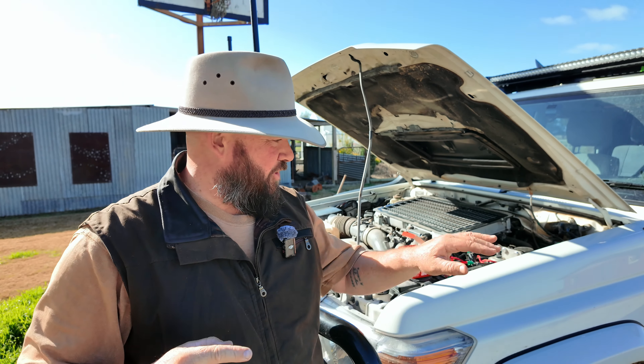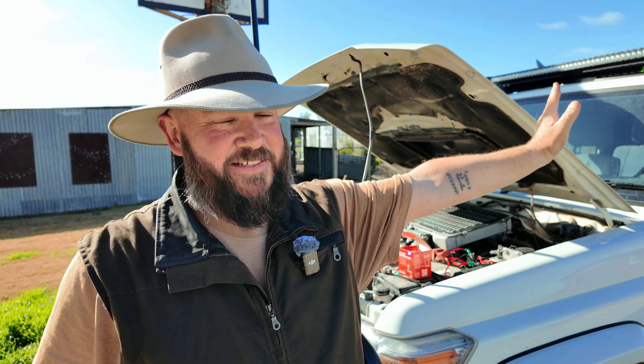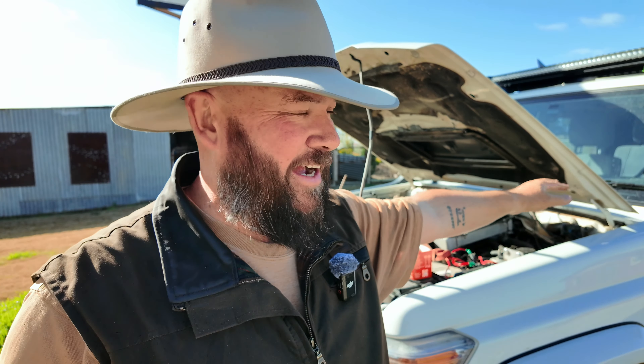My camper trailer doesn't have an ignition wire, and I don't want to run another wire from the trailer into the vehicle. So what I've decided to do is just bridge the gap between the ignition wire and the 12 volts coming from the front battery. Because of voltage drop it might be down to around 11 volts, but the battery up front is still okay. I'll basically trick it with the ignition — just put a Narva fuse in there to bridge the gap in case something goes wrong.